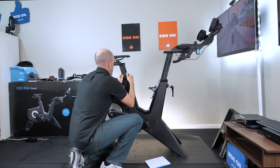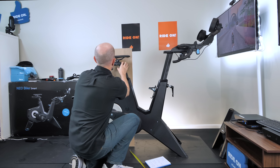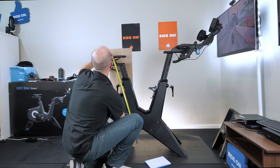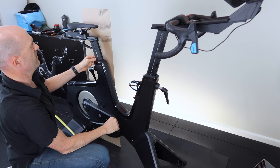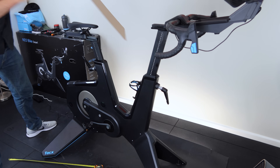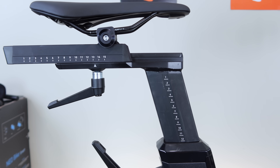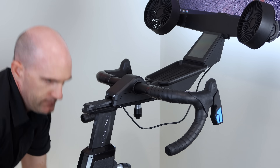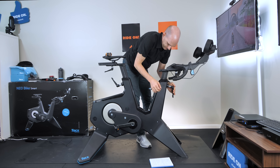Starting with saddle height — it's an interesting one because as soon as you change the saddle fore and aft, the height changes relative to the center of the bottom bracket. I've made a little tool to help position it: by eye it needs to go back six and a half centimeters. Moving it back and forward changes the saddle height, so it's really a two-dimensional measurement. Tightening everything up — saddle height done. On a little app the numbers would read approximately 12 for saddle height and 13 for the fore and aft.